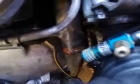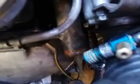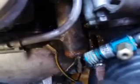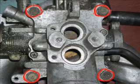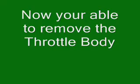To prevent water going inside the intake manifold when removing the throttle body, you have to remove the bottom radiator hose so the water exits, so there's no water in the top end of the engine, the throttle body, the head. So just enough. Lastly, just 4 12mm bolts. They held on.